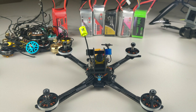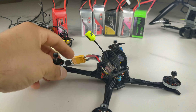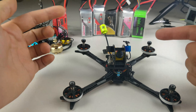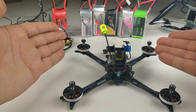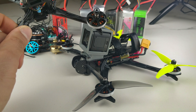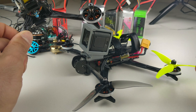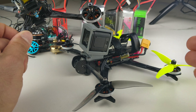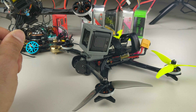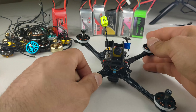This video is really more about food for thought and maybe it'll help drive the direction the next time you build a quad. The quad here is the Power Pick 5-inch. The build is very ugly — I just built it to test things. It's got the new drive train from FPV Cycle: the very cheap 37/30-amp 4S toothpick board with the 2203 3450KV motors. The 5-inch version with the same drive train and 5125 props from Gemfan flies beautifully on 4S with zero issues on default Betaflight 4.1.5 firmware.